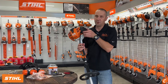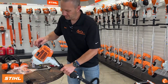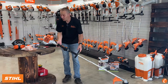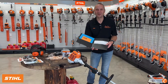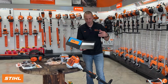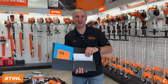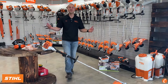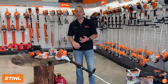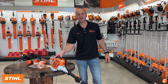How do we start this again? Prime it five times, choke it just like that. There we go — your Stihl FS-94R string trimmer. Don't forget to refer to your manual. I've given you a good quick overview of the high-line things you need to know, but it's always a good idea to dive into your Stihl FS-94R trimmer manual as you break this out for the first time. Have fun! If you have more questions, stop by Carl's Mower & Saw — we can set you up with a full line of accessories, optional trimmer heads, better face protection, better ear muffs, all that stuff. Stop by your local dealer, Carl's Mower & Saw.